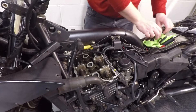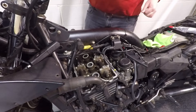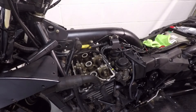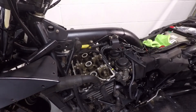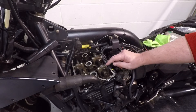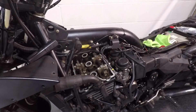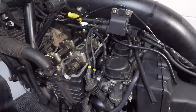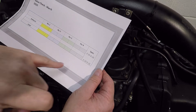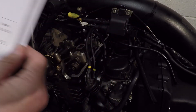I have a plug tool for measuring the gap and four new plugs, but obviously won't put those back in until I've finished doing the valve clearances. I want the lobe of the cam completely opposite where the shim is, so I can check the number one inlet valves on either side. I've done myself up a little table. My inlet spec is 0.1 to 0.15mm. The first thing is a quick test on the inlet side — am I less than 0.1? Because if I am, I know that's out.